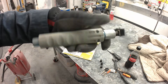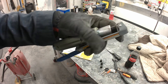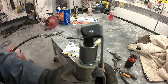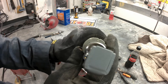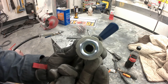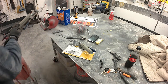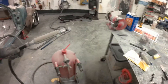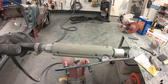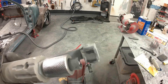It stops the air and the abrasive quite quickly, and it's easy to break down if you get a clog in it. It threads right onto the fitting that comes on the end of the hose with your Harbor Freight blaster. There's rubber and then a metal plate that does the stopping. This unit does wear out — the rubber and ceramic wear a little bit — but the thing that really gets you is that flat metal piece, which I'm about to show you right now.